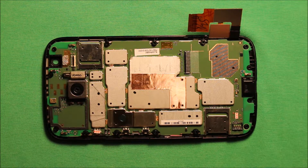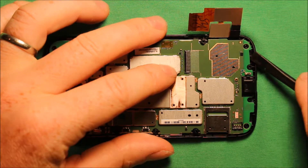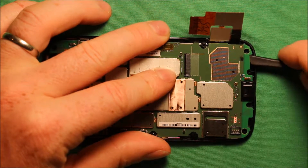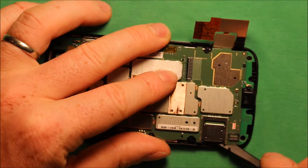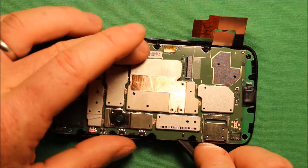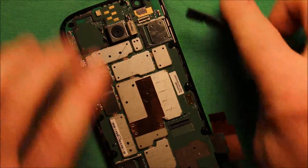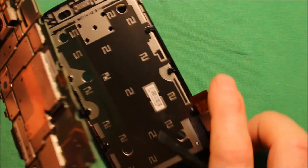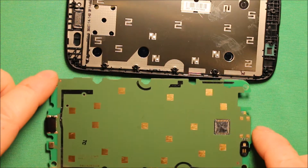To remove the logic board, you will need some kind of pry tool. Start right in one corner and just carefully go in and wiggle around a little bit — you can see the whole thing wiggling. Work over to the other corner; it has adhesive under it so you have to be careful. Work it around — these corners tend to hold a little bit better so if the corners pop loose you are good. Just go careful and steady so you don't damage anything.